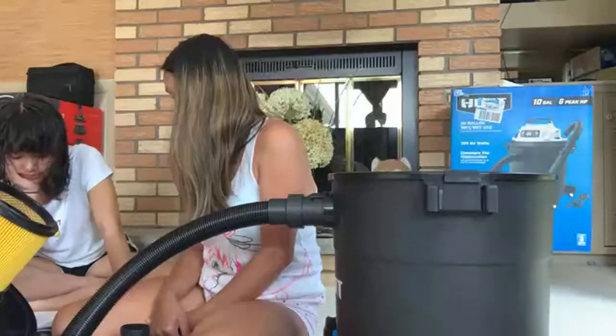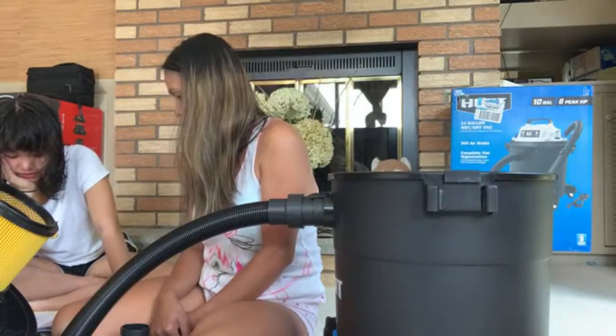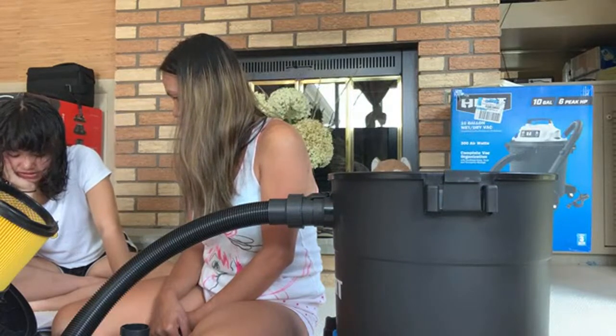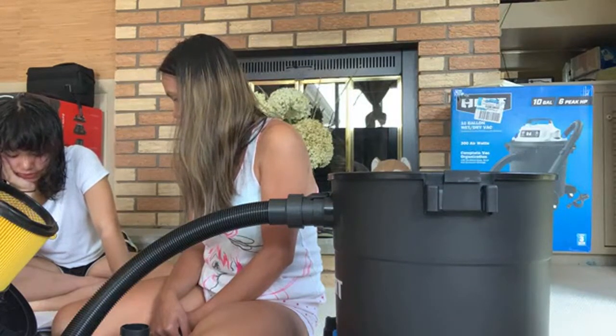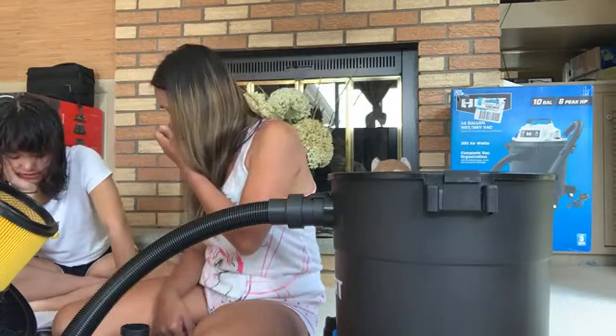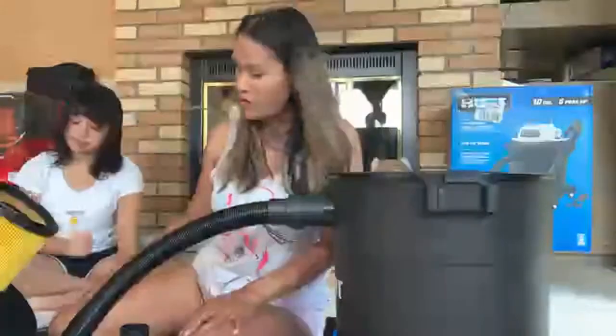With the removed power head in an upside down position, carefully remove the wet filter. Use a mild soap and water solution to wash the foam wet filter and rinse with clean water. Allow the wet filter to air dry for 24 hours before installing into the cage.